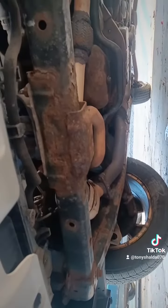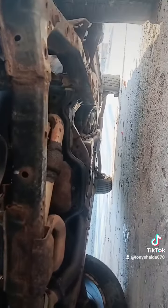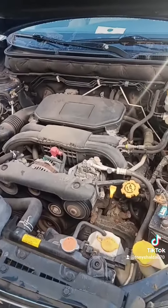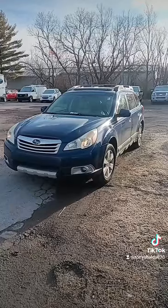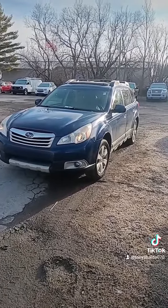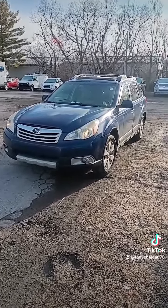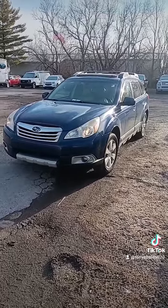On these cars, it isn't the end of the world — that suspension cradle isn't that hard to change, and this car appears to be worth the repair, so I'll take it. It doesn't even appear to have leaking head gaskets, which is kind of weird; somebody must have changed them recently. But if you're considering buying any foreign car — frame or unibody — and there's even the slightest chance it's been driven across the rust belt, even just once, go underneath and check all of the high-strength steel and tube frame steel with a hammer. That might save your life.